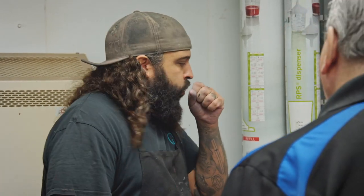I did notice some sand scratches though. All that'll be gone — for pre-paint we finish it off in 220. Nobody paints over 220, but because it's a pre-paint, it's okay, so it'll shrink back into it. Then we'll block it out with 320, then sand the whole car with 600 — it'll be like a sheet of glass. But you don't want it too smooth or else it won't adhere; 600 you can do. Will and I talked about the sand scratches — no problem, it's expected. They leave it a little rougher when they do the pre-paint, and that all goes away. It's just another step to ensure your final product is going to be good. I have full confidence in Will's painting abilities — the proof speaks for itself.